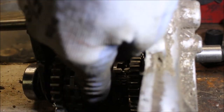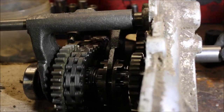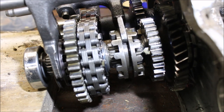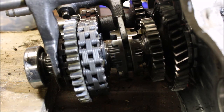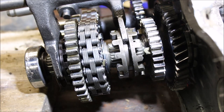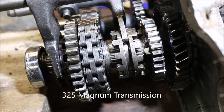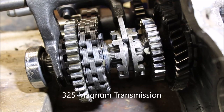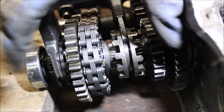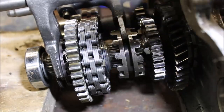You can see it's all rounded off. There are two things I could do: try to use a press and pull this all apart, or — if you're like me and you've got connections — I actually have a spare tranny from what I think was a 335; they're pretty identical. So I'm going to strip that one apart, take that gear cluster out, and replace it.